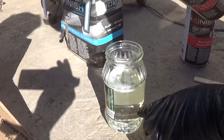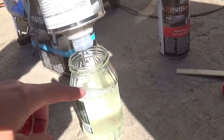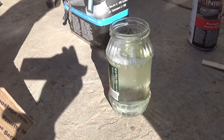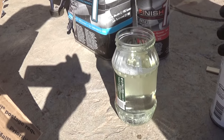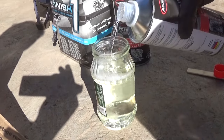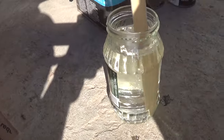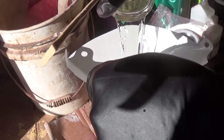You can see we need to add a little bit more. You need to stir it really good when you add all the activator — make sure it's mixed good before you proceed with painting. You need to clean your gun — the gun needs to be perfectly clean before you apply the clear coat. Mix it good now, and use a filter again because you don't want to get stuck in the middle of clear coating.